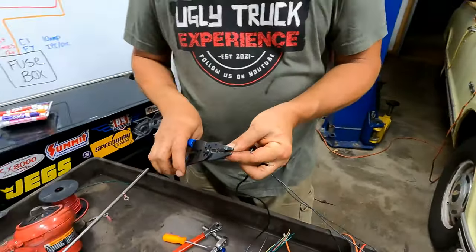And that will be the data wire, okay? Smart wire. Yep. And for some reason, when you look, this wiring or this engine is out of a 2005 or 2004 Tahoe, two-wheel drive. And all these LSs were pretty much the same, all the ones I've messed with. But they start out as purple at the data connector, and then they end up being green at the PCM. Okay, yeah.